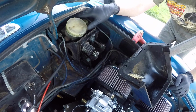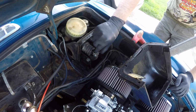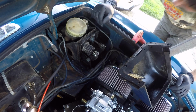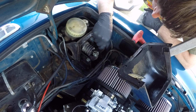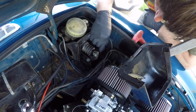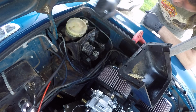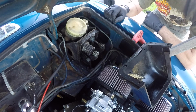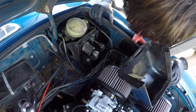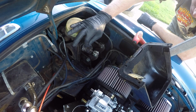I mean, obviously you have to get back in there to disconnect these fittings from the hard lines. A few bolts there, take out the cotter pins, pull these pins, disconnect this, pull these pins, cotter pins, and these pins, because I think we'll probably have to take the pedals off to get this up out of the vehicle. And then what do I have? Bolt there, 2 bolts there, bolt there, and 2 bolts here. And that boot's all shot too.